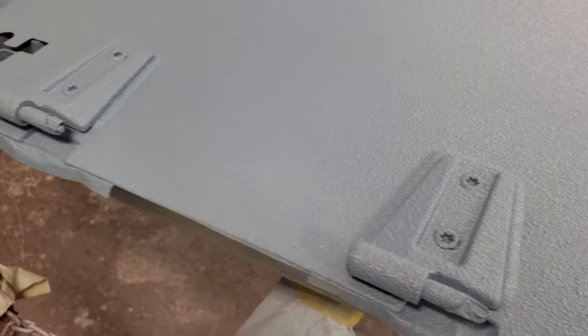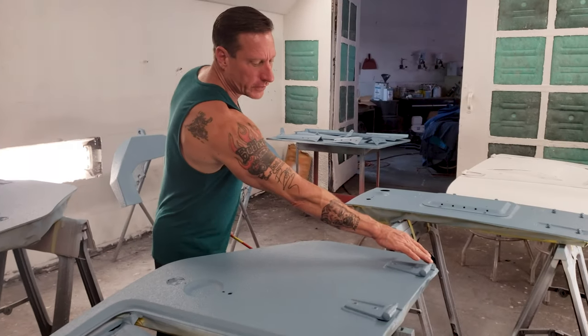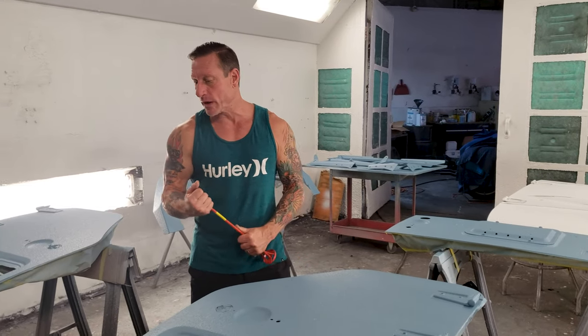A lot of people are like, oh, well, it looks like you didn't take the time to disassemble them, but that's exactly the way the dealer would have done them, because when you do remove Jeep doors, you just remove it from a Torx from the bottom and lift them right off the studs. And great care, of course, was taken, Bob, to protect all the door sleeves and the pin sleeves themselves so that there was no sticking, no binding, no problems like that.